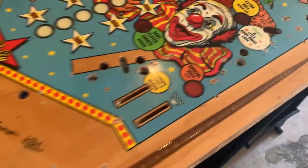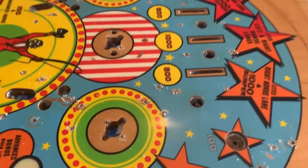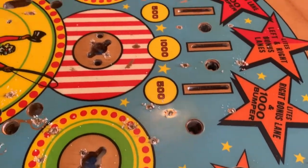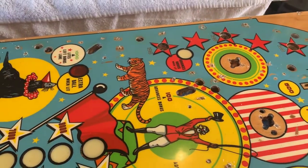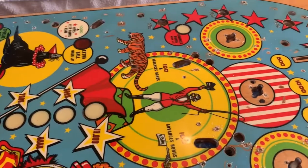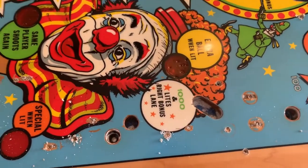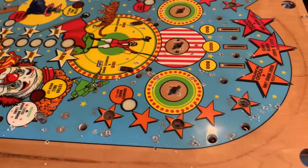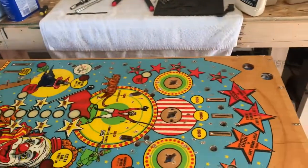So this was a little tough to do, but I went to every single hole and used my little 3/16 rake bit, which is about as big as the screw threads, and just took the top layer off. Most of the stuff you're seeing is gunk that got built up in the holes that it pulled out, but like here. So we'll get the Dremel out and do the holes, and then we'll wipe it down with naphtha and wax it.